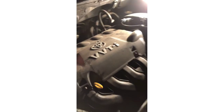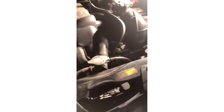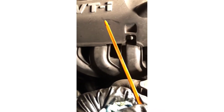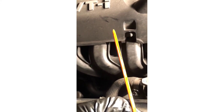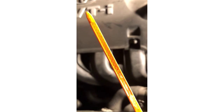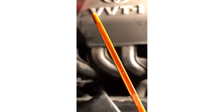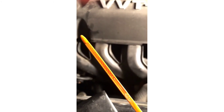Then I will check the oil level — it may not give good readings because the car is up in the air, but it's really close. Where you see shiny, that's where the oil is. It's supposed to be a little bit more than the F mark, right about there, because some of the oil is going to be sucked in by the oil filter. So far so good — I'll get a better reading when I lower the car.